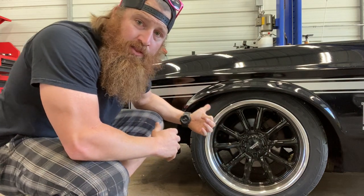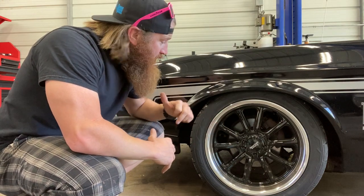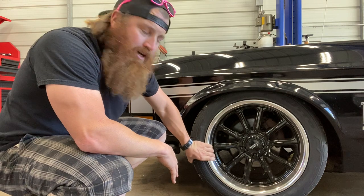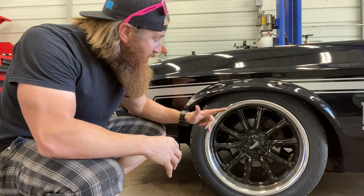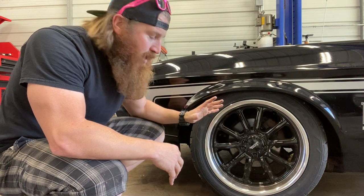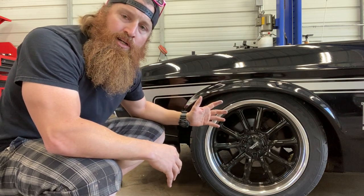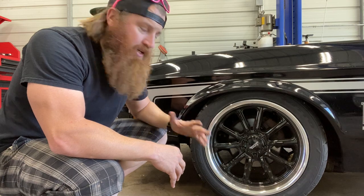I did get some new shoes for the car. These are VN507 American Racings, wrapped in Nitto 555s. These front wheels — the rims themselves — are 18x8s. I like my rims like I like my biceps: 18 inches. The fronts have a zero offset. With these, the '71 through '73 Mustangs, you can't have more than a 5-inch backspace on the front wheel or you'll start hitting the control arm. These have a 4.5-inch backspacing — perfect size.